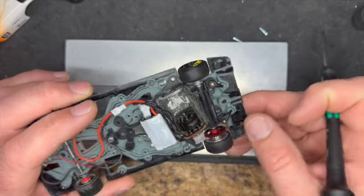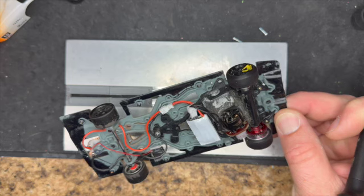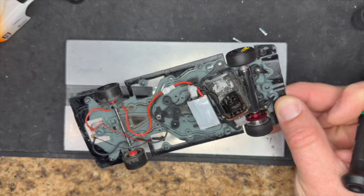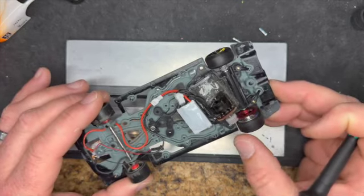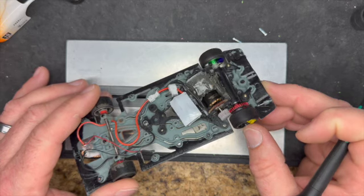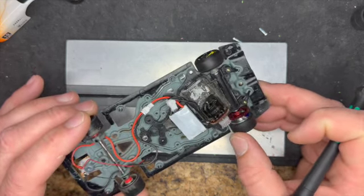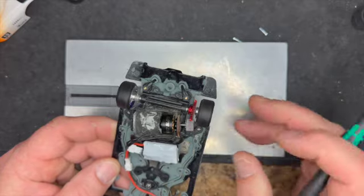We ran this combination for the first time. Nylon pinion. I believe it's the first nylon pinion in the 24-hour event. I could be mistaken, but we were a little leery of it. It lasted the whole race. I did some in-depth inspection. Quite honestly, I'd change the tires, change the body, and I'd probably keep running this car another 24 hours with my post-race inspection of the gear mesh. There is absolutely no wear on this spur.